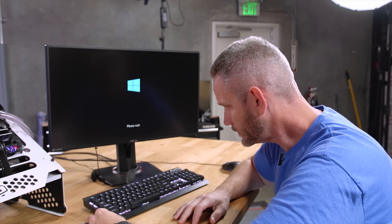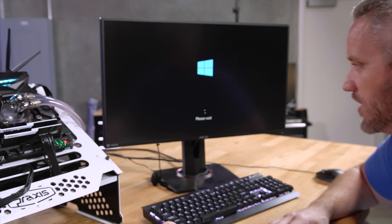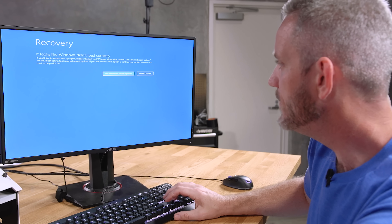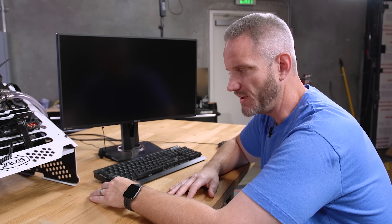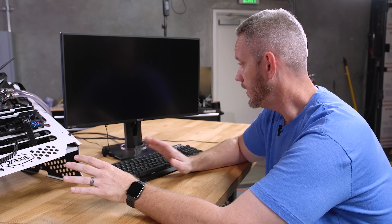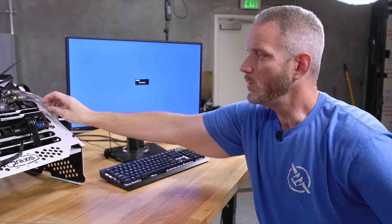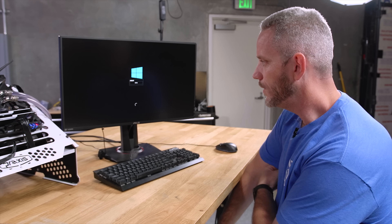Oh, it's going right to repair, which is kind of funny. That's probably because of all the failed boots we had earlier. Windows is like, I remember what you did. Pepperidge Farms remembers. So I'm just going to go right to restart my PC. I'm not going to go straight to safe mode yet because it will boot in safe mode because it just loads the basic VGA driver like you saw right there. But what you'll see here is it will go to the Windows little spinning wheel and then it'll just go black screen as soon as it tries to switch to desktop mode.